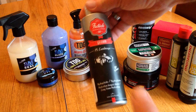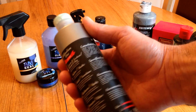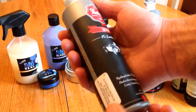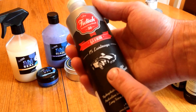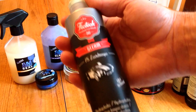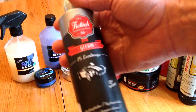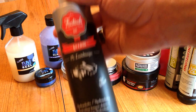This one here, we call this a glaze — this is Gleam. It actually has a level of one on the cut scale. So when we're using it, if we used it on a finishing pad, we'd still get good results — you'd probably remove swirls or fill them. You could go to a yellow pad and get better results; it all depends on your machine and your technique. But what this does is it's actually a sealant. So as well as being a glaze and laying down the glaze and filling properties, it actually puts down a hydrophobic sealant. So you get the properties of the beading and protection levels. You can top with wax after — I always top with wax after, or a quick detailer, just to make sure. So that's Gleam.